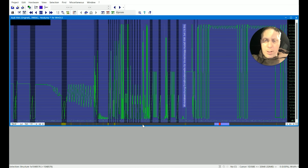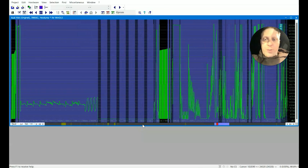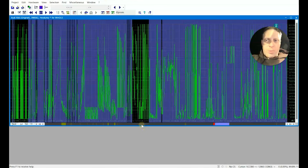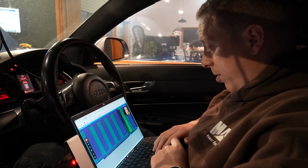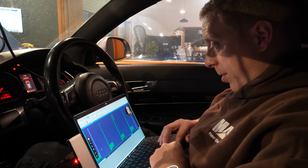So at the minute it's stock, and there's no point running it because of those injectors. You start tuning those first, and we'll go. So I'm going to go away and build a map pack for this. We'll build a bit of a base tune. I've got to take some stuff out, add some stuff in, and we'll start on the fueling system. Once we've done the fueling system, we'll be able to start winding the boost in and start making a bit of power.